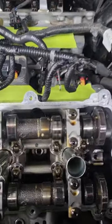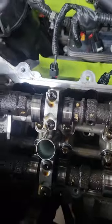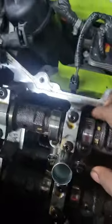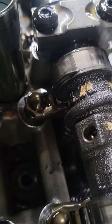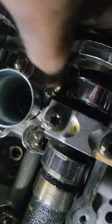I don't know why these Dodge engines do this, but if you hear tapping, that's what it is. This one was doing it just a little bit, but this one here must have been doing it a while because it has eaten through the cam lobe. I'm going to have to replace this camshaft, and I'm also probably going to have to replace this one because it is eating through that one as well. See, it's supposed to be flat all the way across, but this one is grooved because it's been tapping for quite a while.